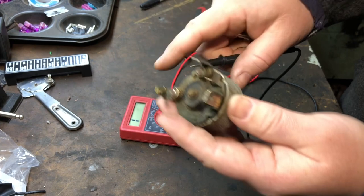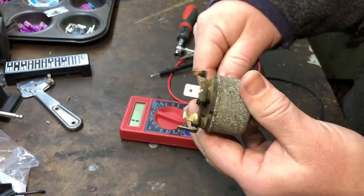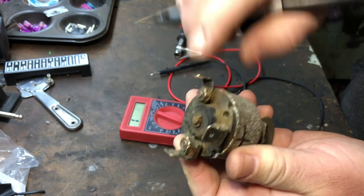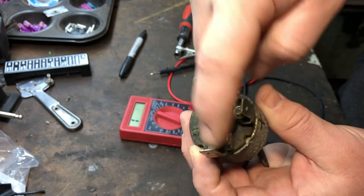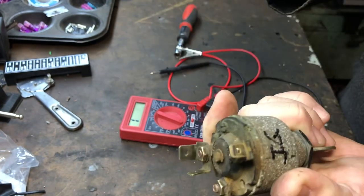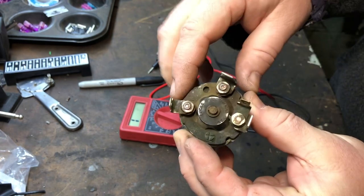Without taking this apart and cleaning it, I'm going to have a different glow plug relay. So I'm not really concerned about using this for the glow plug function — I'm only using it as a starter key basically. So power in, we'll do positive here. And then this was for the starter. Since the starter has a smaller one, I have a feeling it's supposed to go in here and then feed these two. So we'll do this as the starter. I'm going to rearrange these in a way that works with my wiring harness.